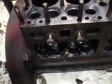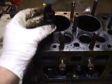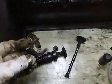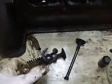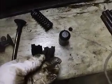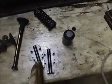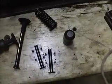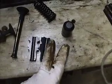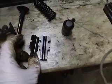This is what the whole assembly looks like when you're able to actually get it out — they just pull out from the top. You have a little clip here that helps hold everything together. And the valve guides are actually split like that so you can open them up, and right here is where the valve rides up and down. You can't get these either — all these valve parts are no longer available. The new ones are one piece, which is a lot better.